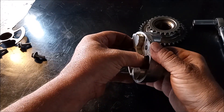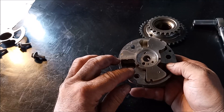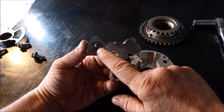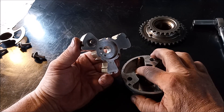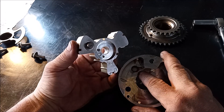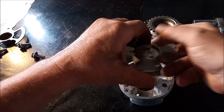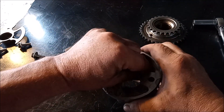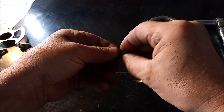Let's take a look at the locking pin. When I take this apart, these little lubricating bits — I think they're Teflon — will fall off, so just keep track of them. Here is the locking pin — it's spring activated and goes down into this hole. You can see the passage for oil to enter and disengage the pin; this little passage is for oil to push this pin back so that the gear can rotate. Each slider has a little leaf spring that keeps it pressed in place.